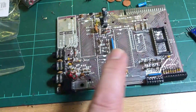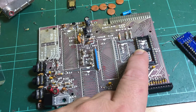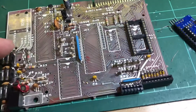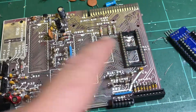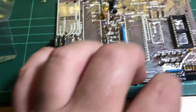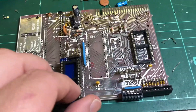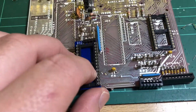That's the RAM. It comes with 2k and I'm going to upgrade it to 16k, but I'm going to keep it as 2k to start with because I've got some 16k and 32k expansion packs that I want to verify work first. That's the ROM — I'm not sure of the exact part number, so I'm going to use one of these 23-to-27 converters and put in a couple of ROMs that I can switch between.